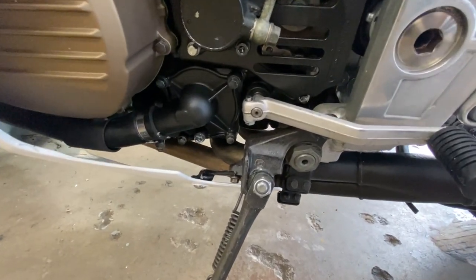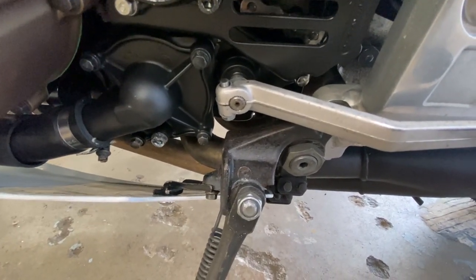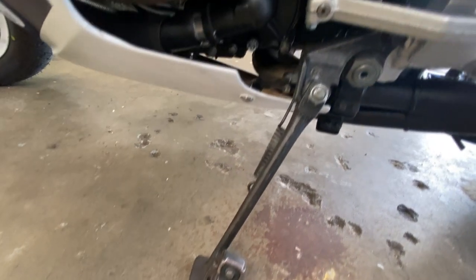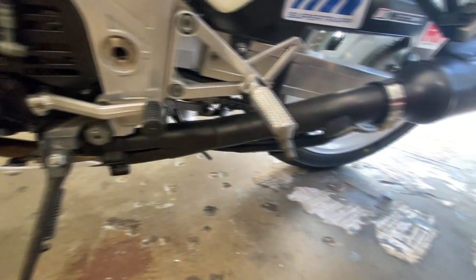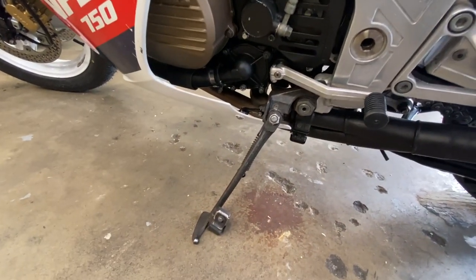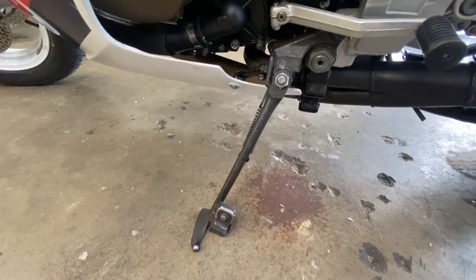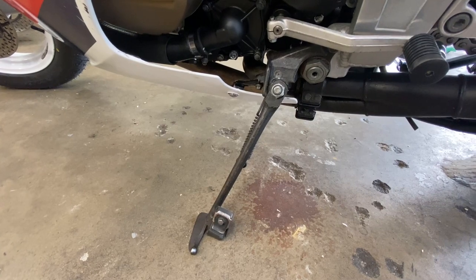The aluminum frame — there's no way it's going to twist, and it has not twisted. That bracket that bolts up as part of the engine mount assembly is not bent either. This is just too short the way they designed and engineered it. The other reason it can happen is if you have larger tires as far as the height profile goes — that is not the case on this bike, these are stock size tires. So you have to look for the root cause first. I'm going to lengthen it because I just don't like it leaning over so far. It's a pain in the ass and it just doesn't look right.